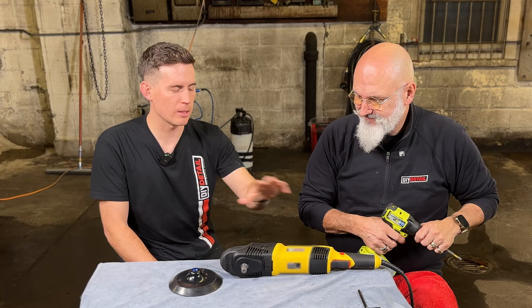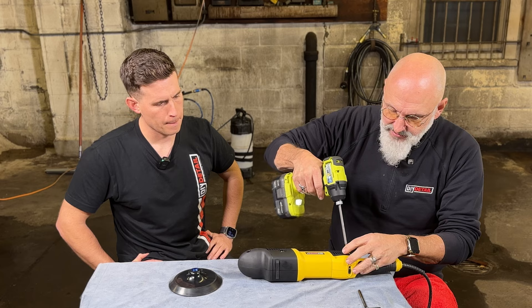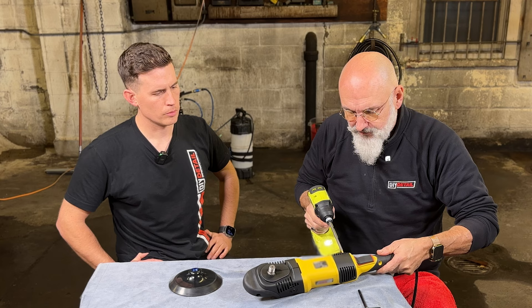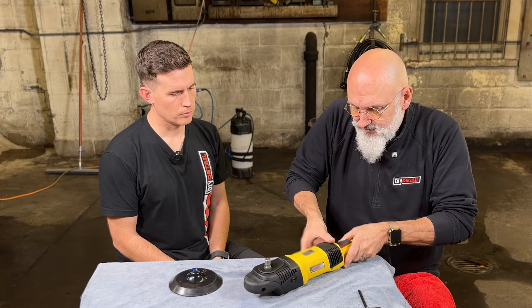We also have a rest position here — when the machine is resting, it's not going to roll away on you. Next, the brushes. Brushes are one of the wear items on a machine that you should be able to change easily yourself. Sometimes on other machines you have to take half the casing apart to get to the brush. On ours, we just have two little screws — this piece pops off and we have access to the brushes.